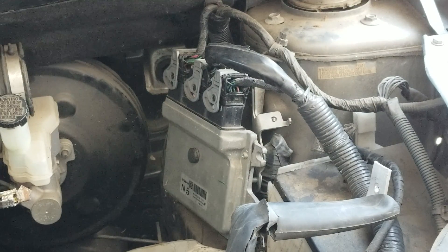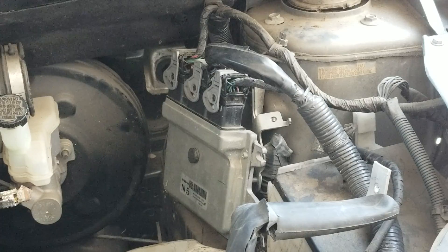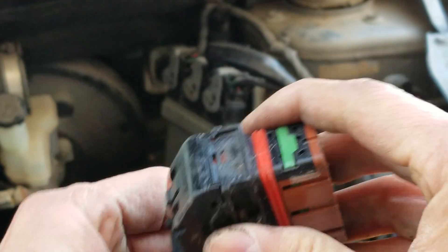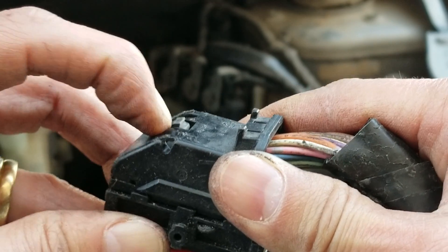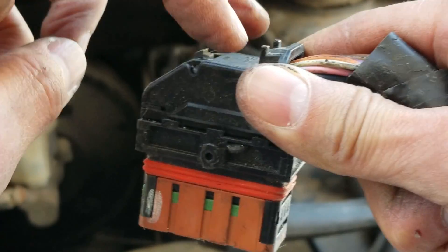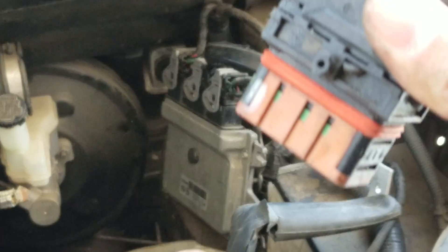What I'm going to show you right now is pretty critical. There are little tiny buttons on top of those three plugs. The plugs are mounted down like that — you will need to press down this button, and then there's a gray latch. You're going to pull it toward the front toward the driver's seat, and then it's going to unlock by itself. After that you can pull out the plug and unplug it.